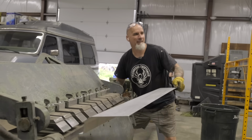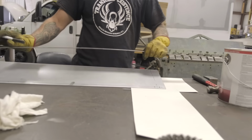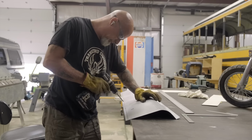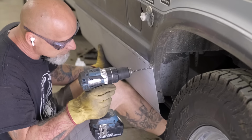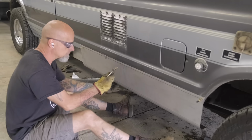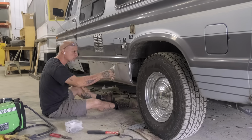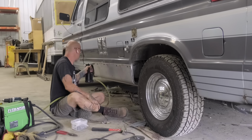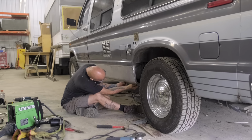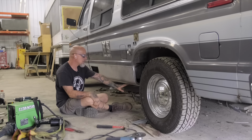On here about half inch away, and that's where our rivet row will be, right like so. It's almost 45 inches, so I can do like 9 equal spaces and 8 fasteners in here. So now those two panels can be basically clamped together and I can tack weld all that completely across there, and that will attach that to that inner rocker panel.